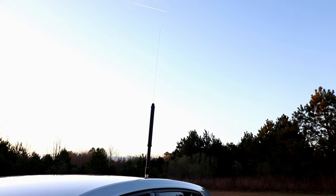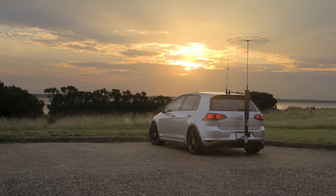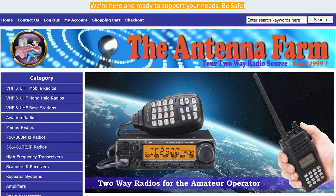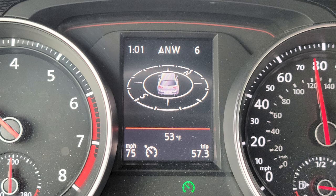This mount is specified for antennas between 30 megahertz and 1 gigahertz as a minimum. I found it would tune just fine with all of my antennas, and it even tunes my ATAS 120A — Yaesu's automatic tuning antenna system for HF. I don't strictly need the ATAS for HF because I have a Scorpion HF antenna, but it's good to have options. Like the Larson mount, this Electro Mag Wave mount restores the GPS signal to my infotainment system. I ordered the mount from the Antenna Farm, had them trim the cables to 24 inches and install SMA connectors. For the GPS cable, I ordered an SMA male to Fakra C male adapter from Amazon, which allowed me to connect the combination mount directly to the car's factory GPS cable. My car doesn't have factory navigation, but having the GPS signal lets my compass work and keeps my clock accurate.